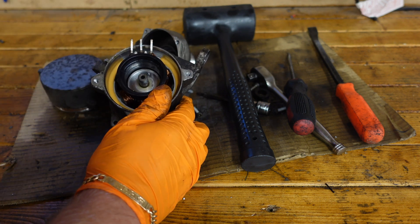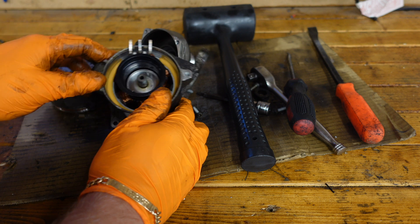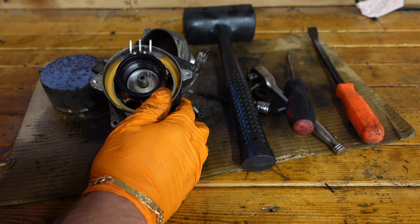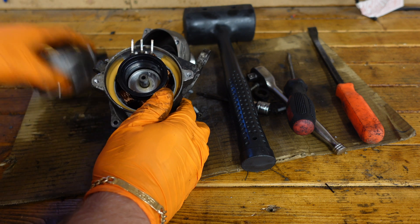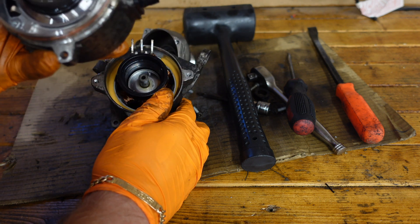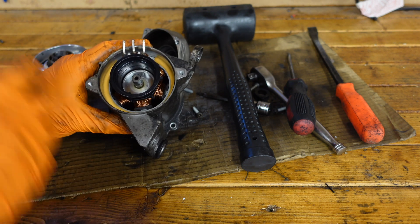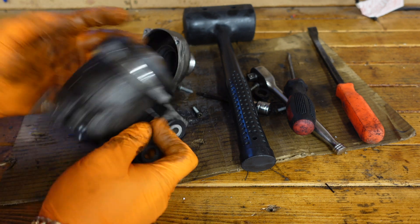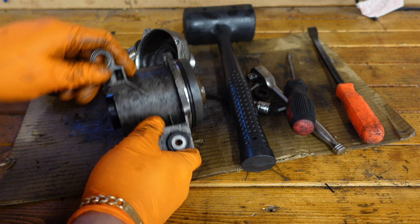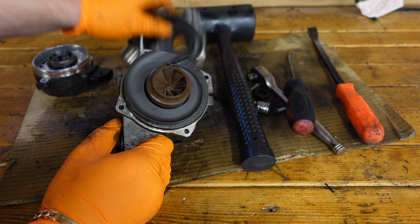You can see that was plastic, so it was guaranteed to fail — just like the roof motors on the 6 series use plastic cogs driving against metal, which break, or the seats on the E60. Anything putting plastic against metal on an input shaft is guaranteed to fail. Many of you will ask if you can replace the cog — I haven't seen a replacement anywhere, and to be honest the time and cost of replacing that cog means you may as well just buy a new water pump.